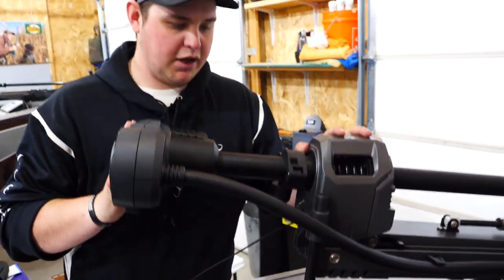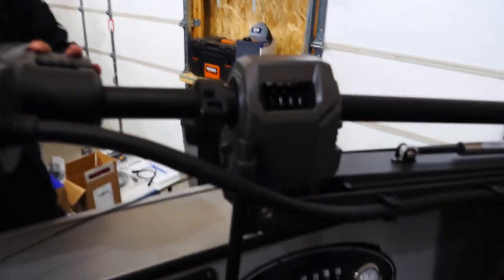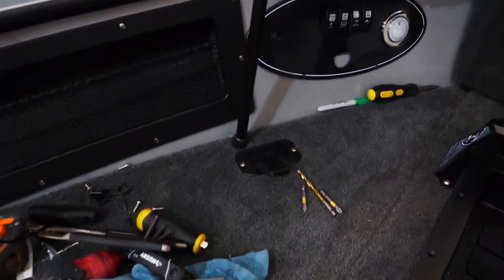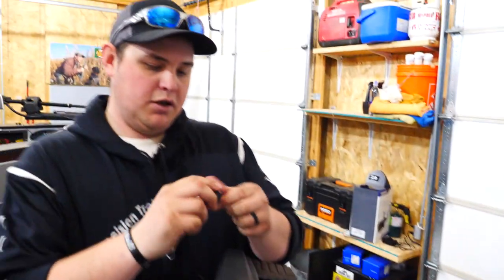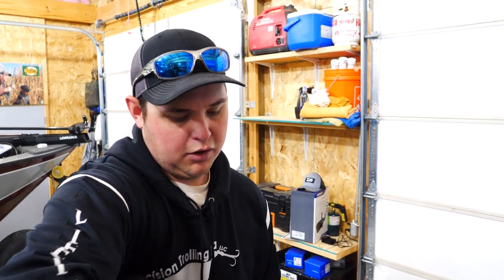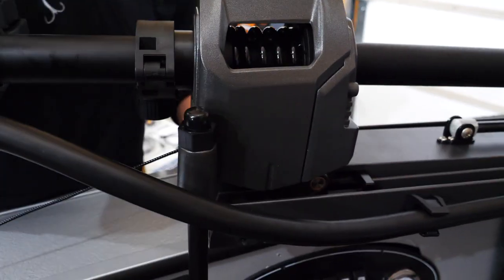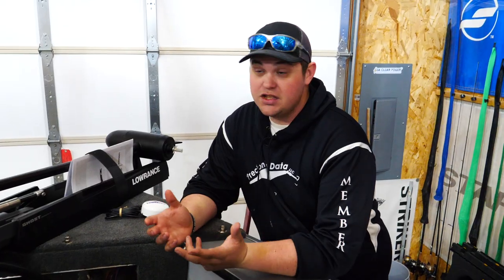You'll hear an actual click — and that's where it's sitting right there on the floor of the boat, so now it can't go anywhere. The next thing you do is there's a little screw nut that you tighten all the way up on there, and then a pretty little dress cap that you put over the top, and then that's pretty much done.